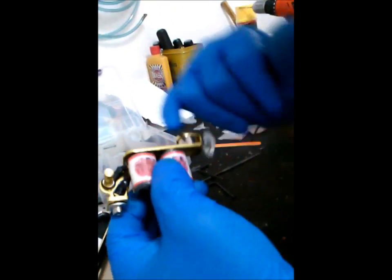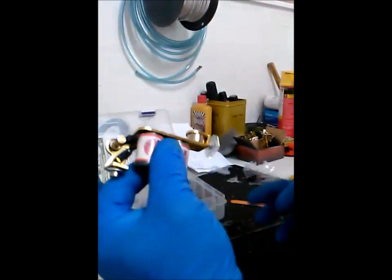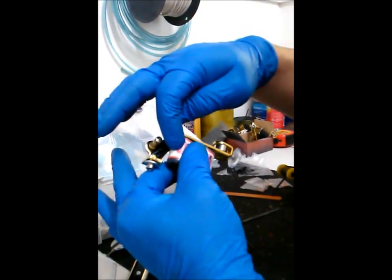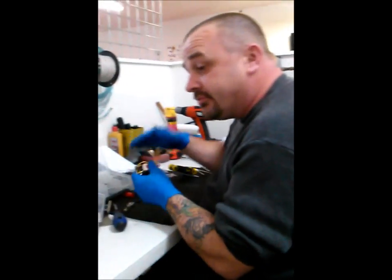Anyway, when you loosen a coil, just so you all know, there's this really thin wire that runs from coil to coil in the very bottom here on the back. You're not going to see it right here. You want to hold your thumb on these coils when you turn this bottom nut, and what that does is it prevents the coil from turning and you pulling that wire out. And your coils are no good, replace them.